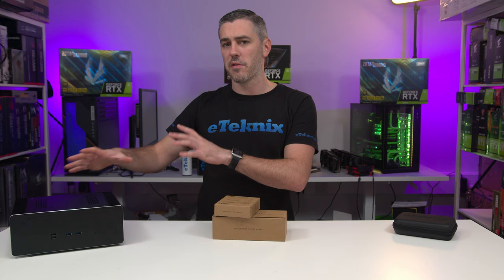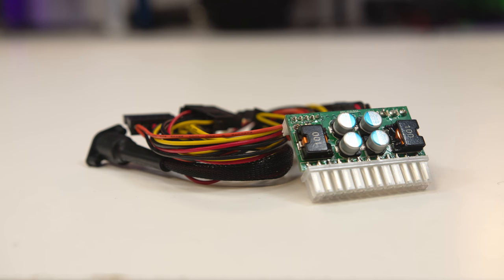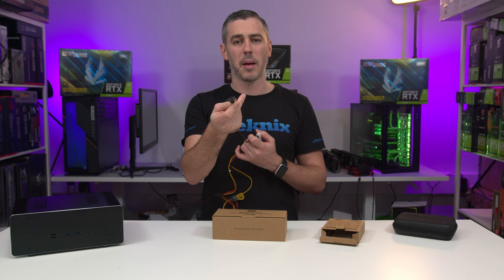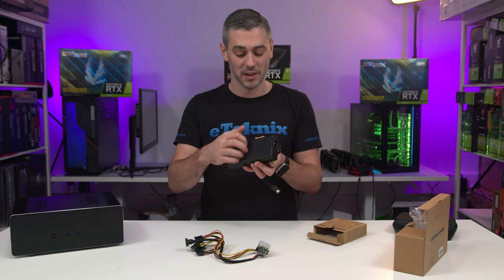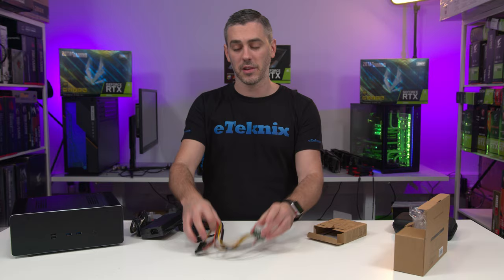ACASA claimed that you can put any CPU into this up to 65 watts. So how do they get away with making it completely silent? Well, they sent us this, which is called the Compact Power 150. Essentially what it is, is everything that you need to plug a motherboard in, storage devices, and so forth. We have a 24-pin connector, and then off of that is SATA, Molex, and also our CPU EPS connector. Above and beyond that is a DIN connector — a 4-pin power DIN — and the way you connect into it is with what looks like a laptop brick. It looks very good quality with brushed plastic on it. This connector is going to be plugged in using a standard kettle lead, routing around to the back of the case, which connects into the rest of our components.